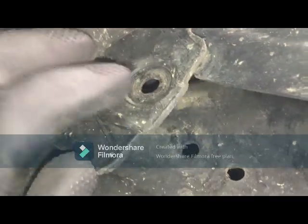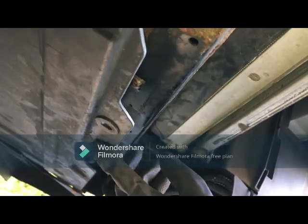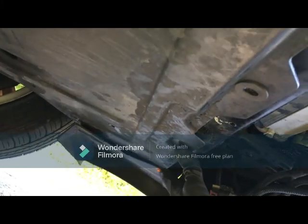Okay, we're under the car. I already took the old starter motor out, so everything is loose. But if you're just starting out to do this, and you have a Buick 2012 Verano, you'll have to undo this side, take the screw out here, take the screw out on this side, and this side. And then there are things you pop out. Take this torque screw out.